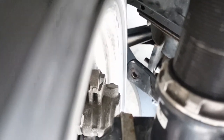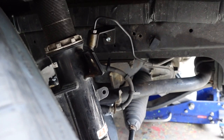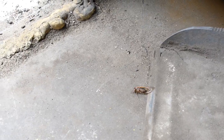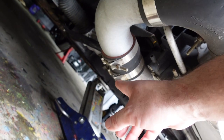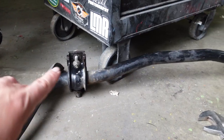It's actually hitting the sway bar a little — looks like just enough that it's hitting the wheel on full lock. Even if I could get the end links to work, I don't think I can run a sway bar with this kit. Sway bar is an issue — on a lot of big angle kits, like my Fox Body kit, I couldn't run the sway bar with that either. Really didn't want to do it, but I took the sway bar out. It's potentially going to rub the tire and that could be dangerous. To remove it, take the brace out from underneath the K-member and front radiator support — it's all 15mm and pretty quick with an impact.